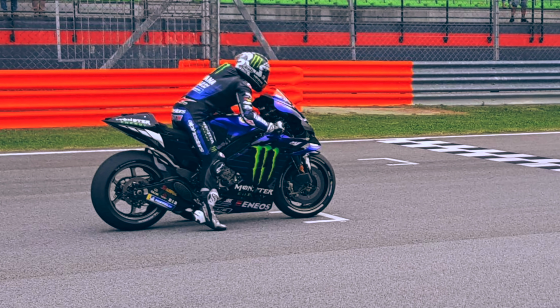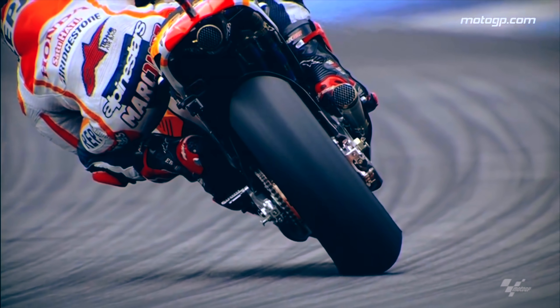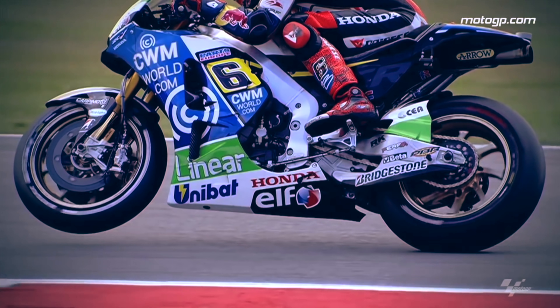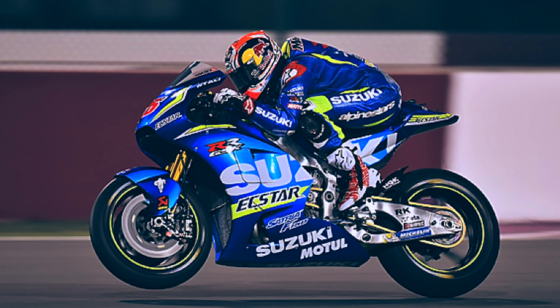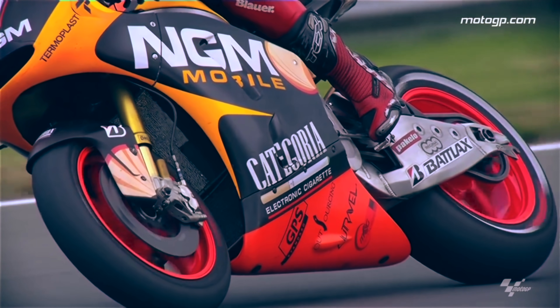Some factories have opted to lower the front instead of the rear, which has a similar effect at the start, but is not so useful when exiting corners. Another important aspect in making MotoGP bikes accelerate as hard as possible, as well as maintaining stability, is to control rear tire spin. Modern MotoGP bikes have so much horsepower that the rear tire spins on all gears. To deal with this, factories have developed seamless shift gearboxes. In a traditional gearbox you have to stop the movement of the transmission when shifting gears; this pause and sudden re-engagement causes more wheel spin and makes the bike rock back and forth. A seamless gearbox has a mechanism that enables two gears to be selected at the same time, but only one transfers power to the rear wheel, engaging the next gear ratio while the previous ratio is still driving — shifting up and down in about 0.01 seconds.